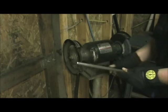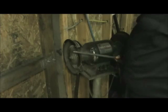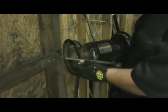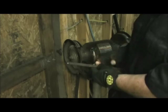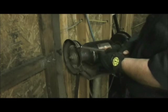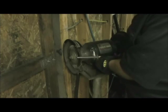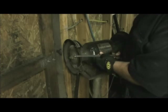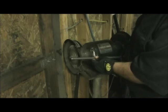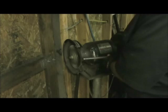These tubes come with a light epoxy coating on them. When I'm sizing it, I strip this coating off so that it gives me a little bit of build-up, because I want a little bit of a press fit. This is kind of like a protection thing — if I'm running the sand roll in there and I get it just a touch loose, when I put the tube in with the epoxy coating, it's going to have a little bit more build-up and make it a tighter fit. But this is how I do it.